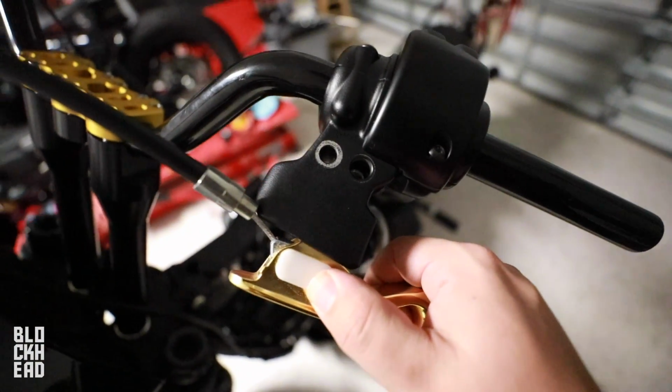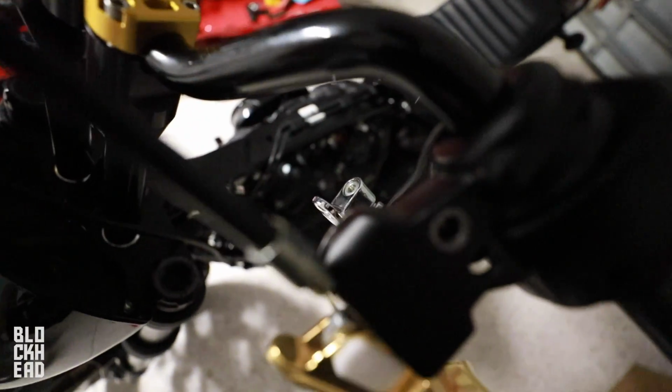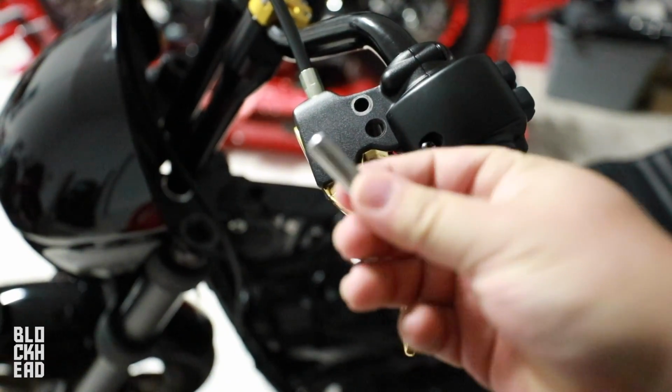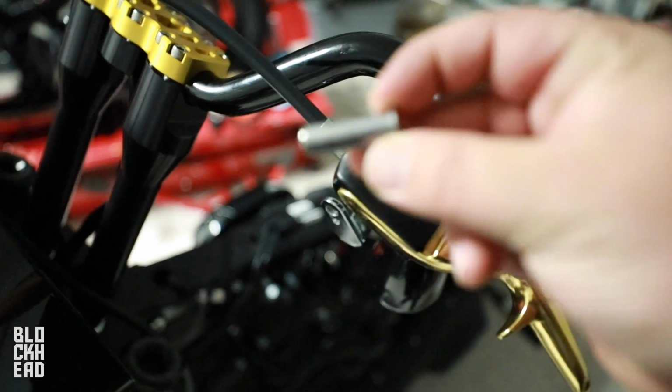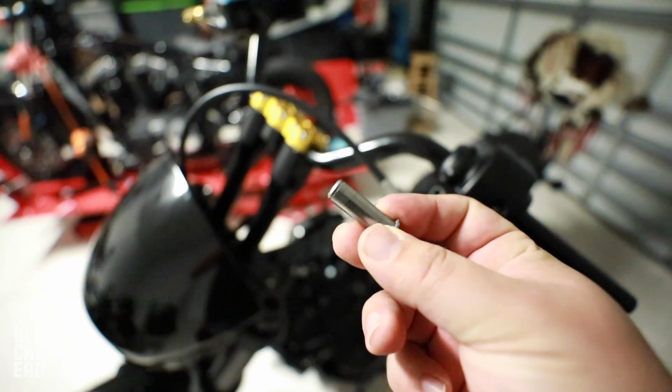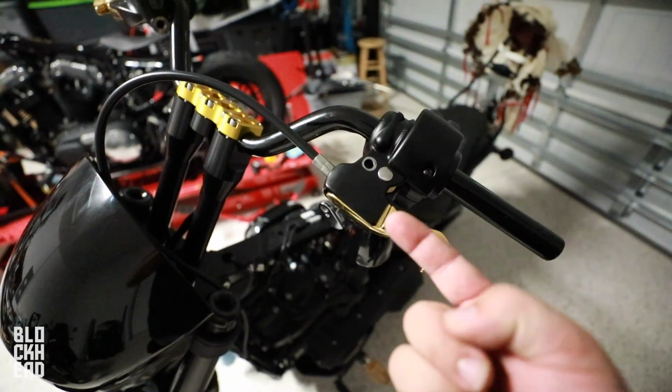And then we're going to put it back into the part on the lever, well, on the bars. So this part through the end. Then you're gonna take the post and put it right back in here. Don't forget, bottom side of that post, you do have to put the retaining ring back on it. Snap ring pliers, snap ring on the bottom.